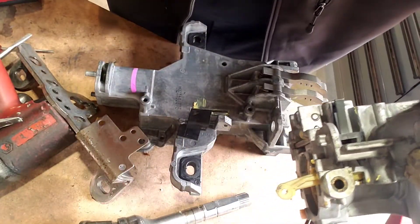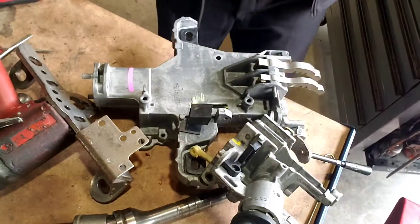It's really common, not just this pin — a lot of these Fords, it's really, really common that this thing fails. Therefore your key just turns like a limp noodle and there's nothing there — it feels like nothing is attached. So this is a 2001 Ford, and this spans for many, many years that Ford did this system. The first step when you have this situation where the key is turning and nothing is happening: take the ignition switch off — two torx screws. When you turn the key, you should see the yellow rod, the yellow plastic piece, come all the way down and go all the way back. Usually what will happen is it will push it down but it won't bring it back, and that's because that pin is broken.